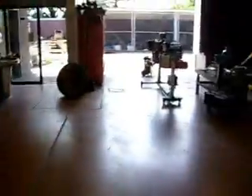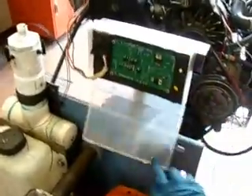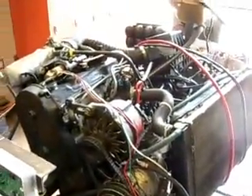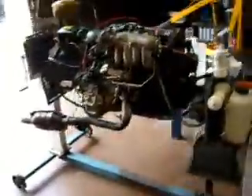And this is their extreme mileage exhibit — potentially the highest-reward project. They're aiming for 100 miles per gallon in a self-imposed challenge. The project involves electrolyzing hydrogen to assist combustion, controlling fuel input to reduce it, plus water injection and alcohol injection on the old VW motor that came out of the electric vehicle. It's been the biggest pain, but they're not ready to give up yet.